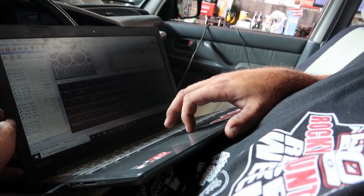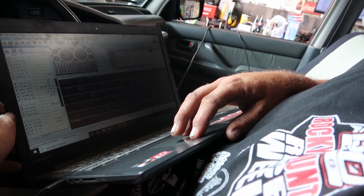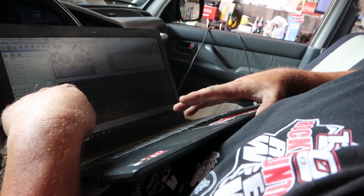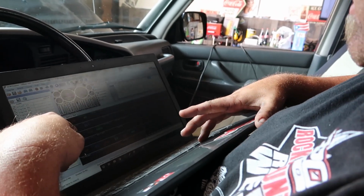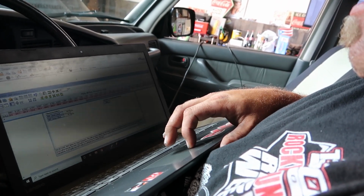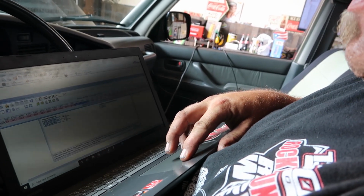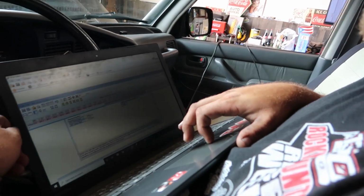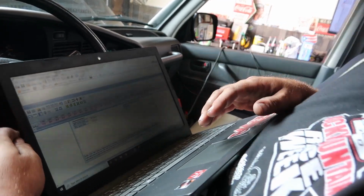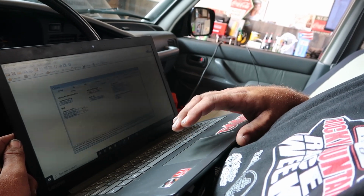Oh, it's not showing you too much. So what happened was, down here you see the mass airflow, the hertz rate. So we can go right there at our 3,300 RPM, and we can see we were at 7286 hertz, and then we can come over here, 72 on our hertz, and we know to pull the fuel above there. So this is all the airflow versus the mass airflow hertz rate. Since we're using the mass air meter, that's basically how we trim the fuel in. So if you change intakes or anything like that on something LS that you're using the mass air meter, that's the main table you're going to be using.